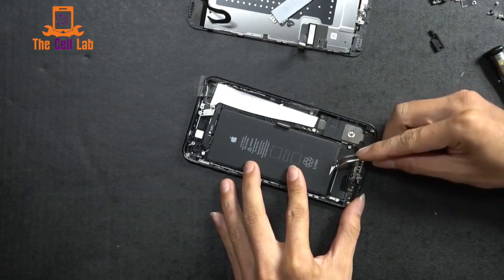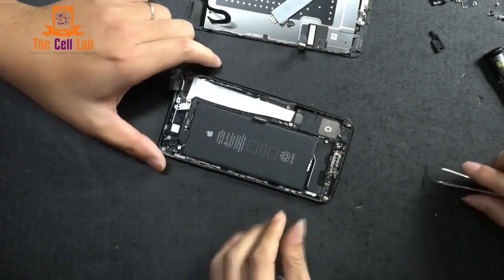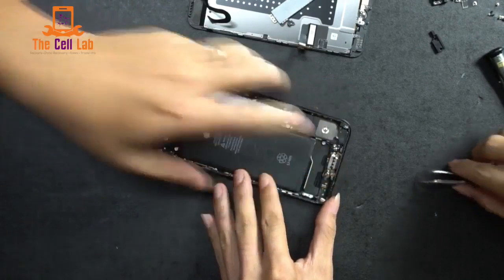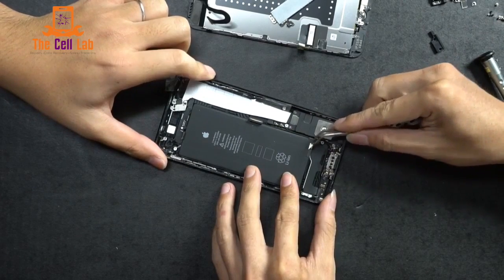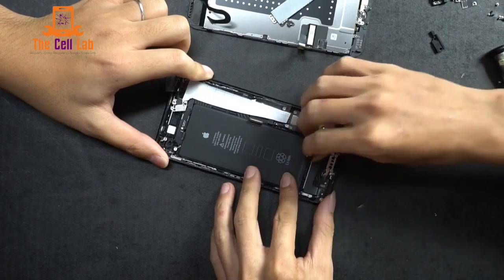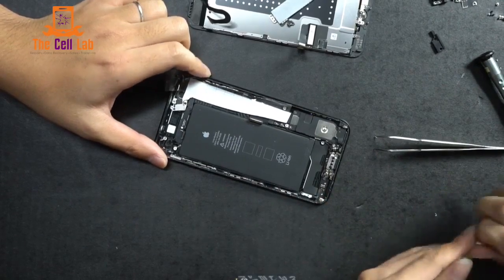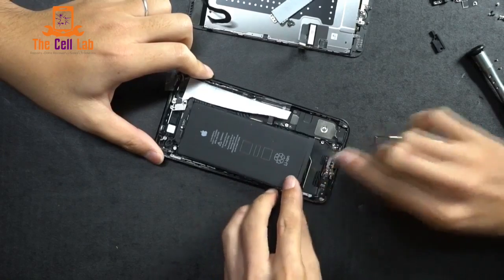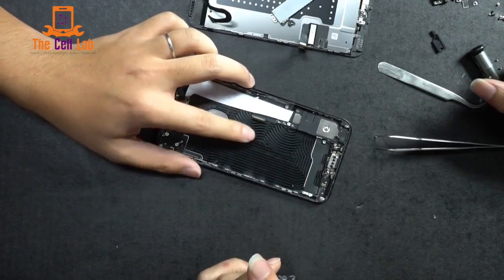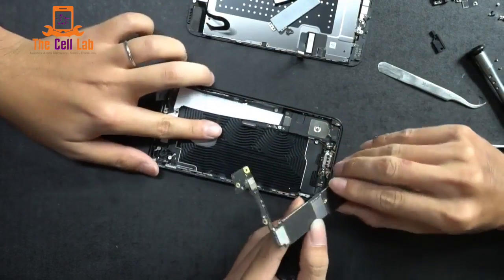You just peel down the adhesive from the battery itself — it's kind of folded over. The motherboard itself — we didn't really talk about it too much — but it's a completely different board, mainly because we went to the A10 processor, so it's supposed to be a lot faster. Subscribe to the channel — we're going to do a whole bunch of speed tests. Out comes the battery very easily. Underneath, the frame is actually contoured — I'm not sure if that's just to keep the machine-milled look or so everything else fits more firmly inside, or possibly even to aid in waterproofing or to combat battery heat.